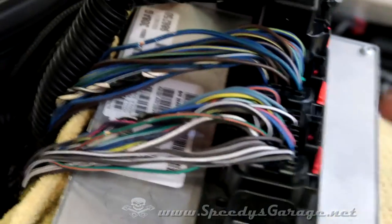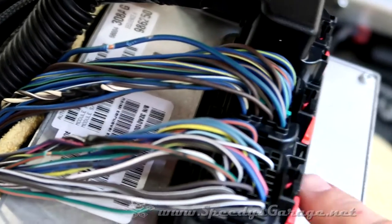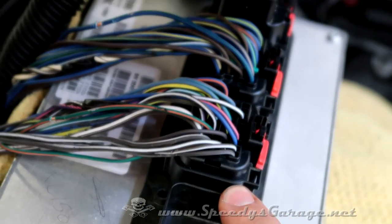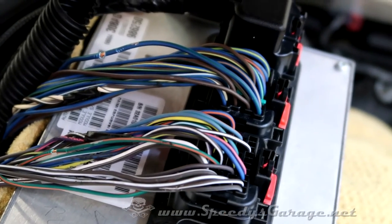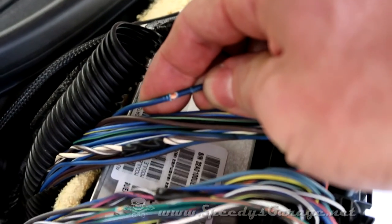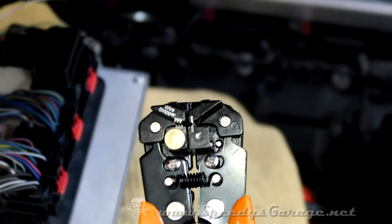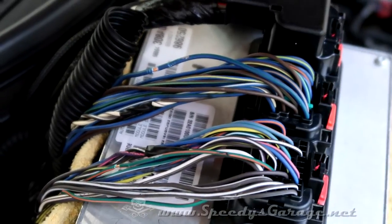This next part can be a little scary, but don't let it bother you — it's just part of hot rodding. You're going to split the wiring harness at pin 10 on connector 2 and pin 26 on connector 3. That's specific to 2009 and 2010 models — later models change the computer, so check to make sure you get the right wires for your application. When I say split the wire, I mean peel back some of the sheath but don't cut the wire. A tool like this works the best — it'll grip the wire and you just gently pull and it will separate the sheath. So that's how I got it done. Now we're ready to solder.